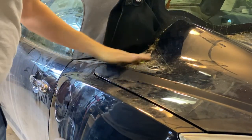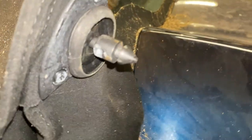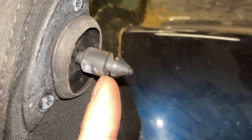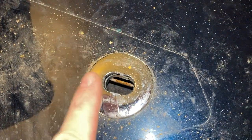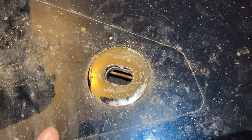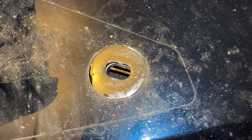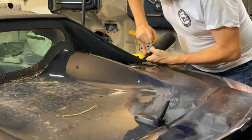Success! Now that we've got this popped, you can see a little bit better — there's a pin here that goes in there. If we look inside the hole we can see that pin in there that has to be pushed out. Normally the electronic release does that for the trunk, but since that's not working in our car, this is what we had to do. So let's pop the other side and then we'll see about opening the trunk itself.